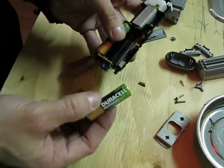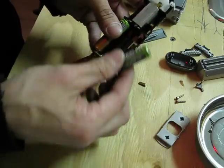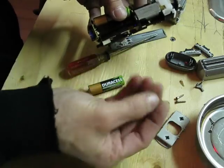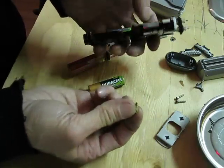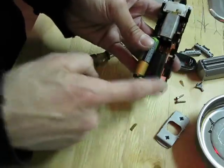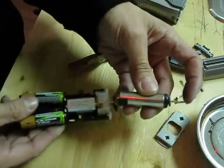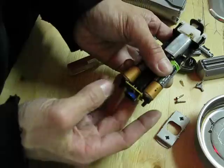Best rechargeable batteries on the market, I think — nickel metal hydride. I've had these for about 10 years now and they still work fine. When you put this in here, because it wasn't designed for a regular standard double-A, it's going to be really loose and won't make contact. So basically what I did was I took a piece of copper, cut a little strip, and folded it in half so I could get a better fit with some tension. The positive is on the bottom side for this particular model. I used a voltmeter to double-check — since it's not labeled, always verify with a voltmeter.